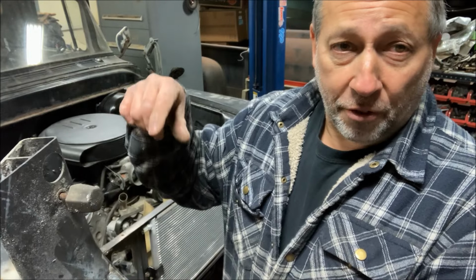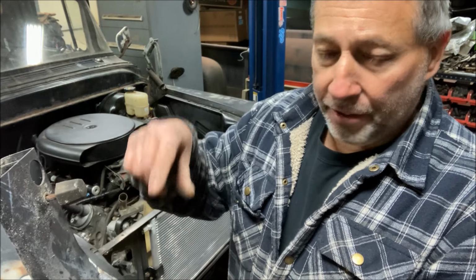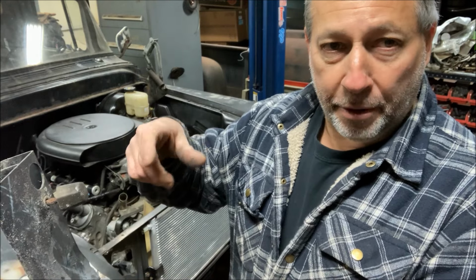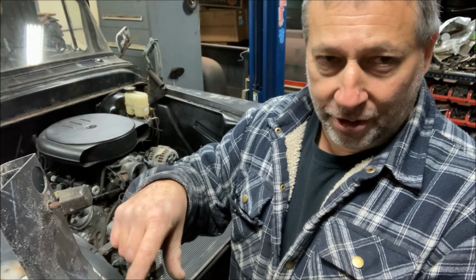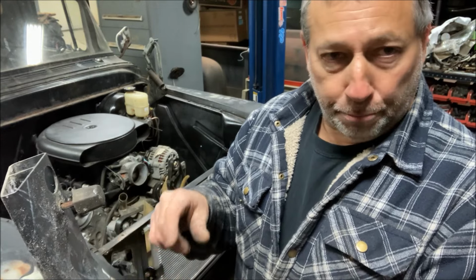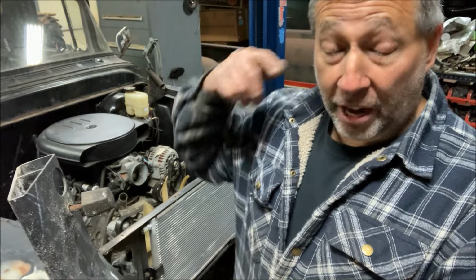Well, that's what I saw them doing with this thing, but it wasn't. You keep the stick out so far back that they call it spray transfer welding. The arc is very far back from the nozzle, and you have to do it to see what it's like. It's almost like spraying metal and making a puddle. It's very different than regular MIG welding. But regardless, I couldn't dial the power down. I just couldn't do it.